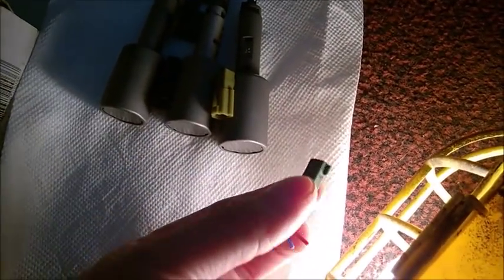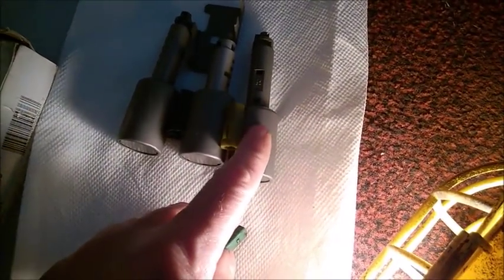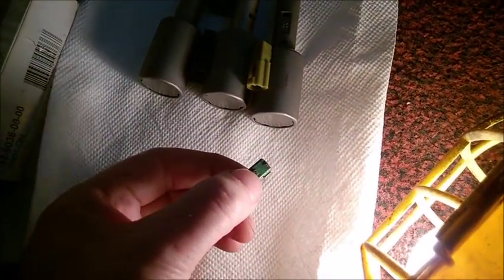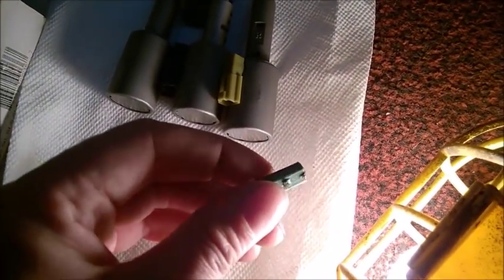When you are going to detach this connector, this is attached to the valve body. You need to remove the solenoid first, and then with the solenoid hanging by the wire, you need to detach it from this guy. I'm going to use another video which I did before, and I'm going to explain how to detach this thing.